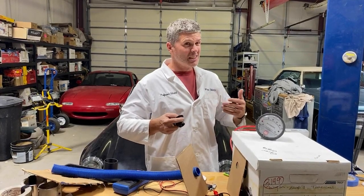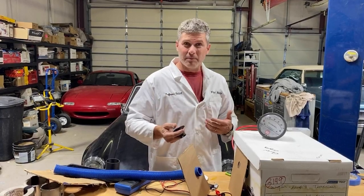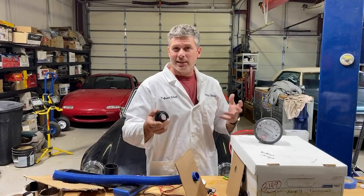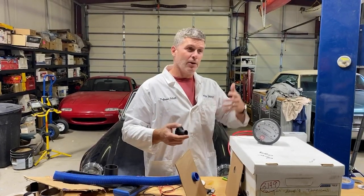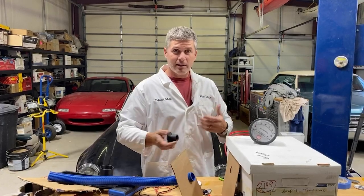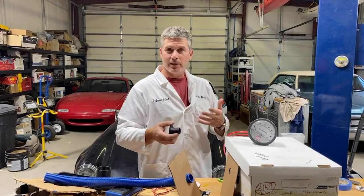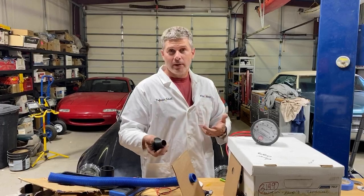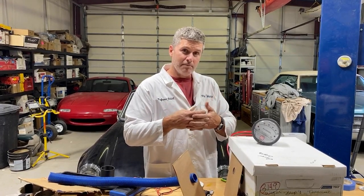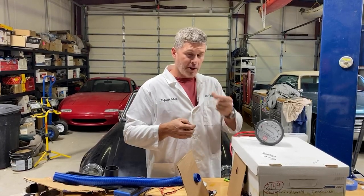You could look at it: did it go wrong or did it go right? Because this radiator did not perform. But luckily at that time we were testing a whole bunch of different radiators, so we were able to tell, well, these ones did perform, this one didn't, so we figured out why, and we figured out what was different about them, and that's how we developed the cross-flow radiator that we use with the very tight mesh, very high mesh or fin density, the thin core.